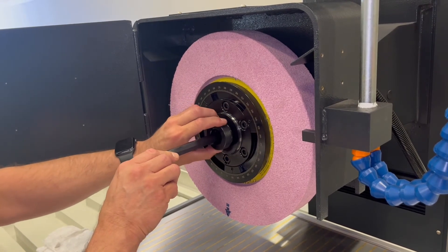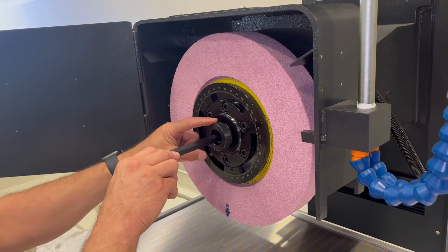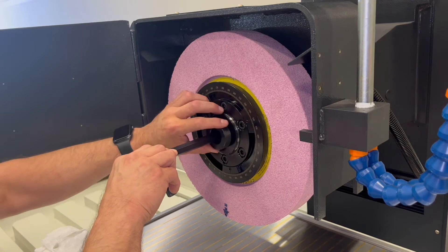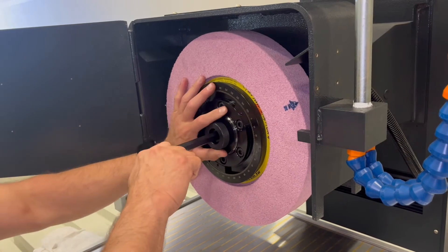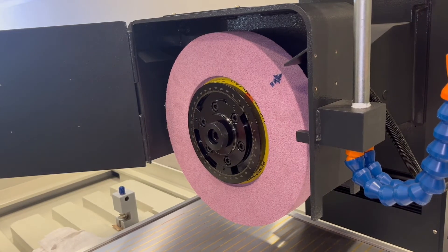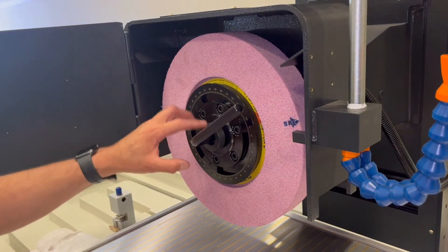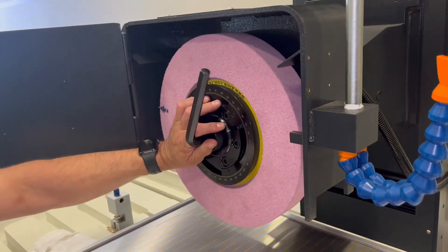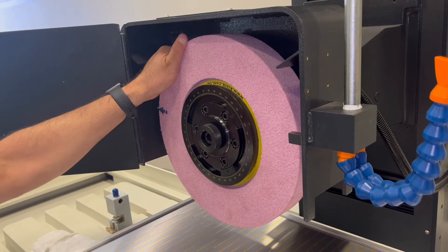Then, at this point, I'm going to continue turning my ID differential screw until my locking nut threads into the wheel flange. As you can see, I've already got it going. Once I have my locking nut threaded all the way down, I can then turn the differential screw to the right against the locking nut. Once that's placed, I can then set my Allen screw with the short end into it and give it a couple taps. The wheel is securely attached to my spindle.